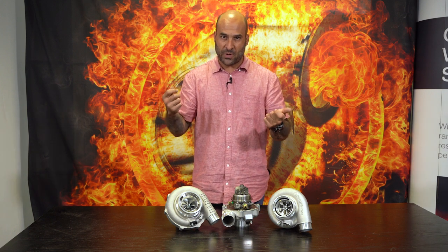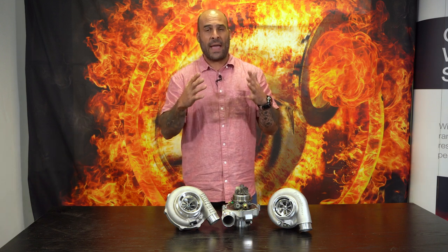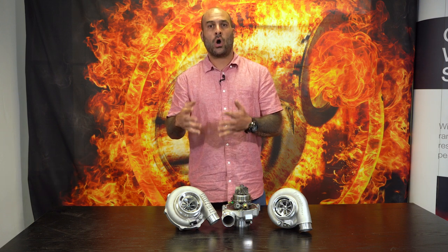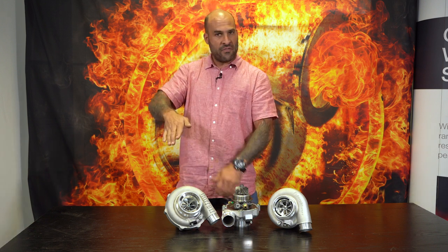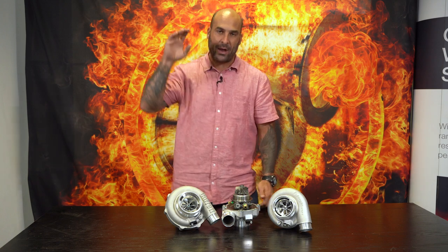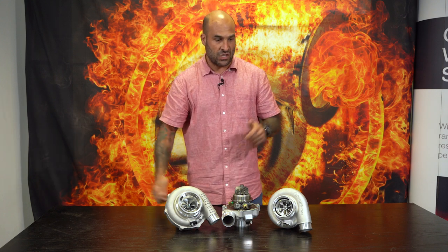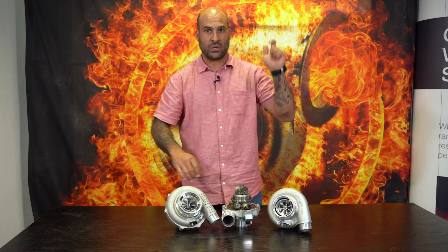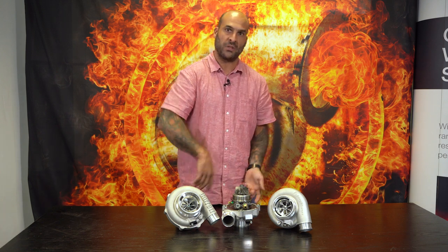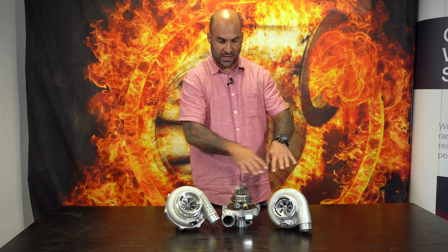When you start getting into high boost pressure ranges where the turbo is already on song, consider a track circuit racer carrying speed through a corner, feathering the throttle rather than fully lifting off. Energy is still coming from the engine into the turbine housing, and very low boost is still showing on the gauge. As you come back onto the throttle — what we call punch response — all three turbochargers will operate essentially the same with very little lag difference between them.